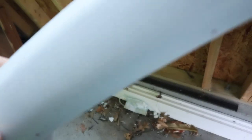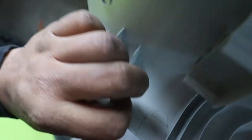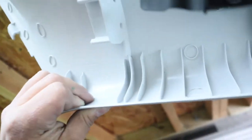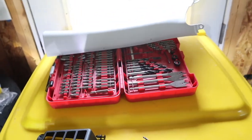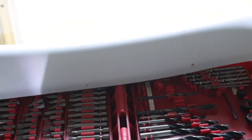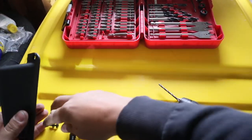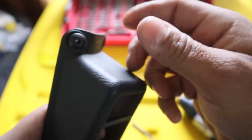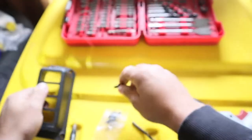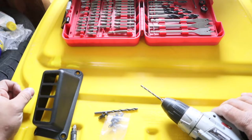We are going to be cutting back here — not a whole lot. But we're going to be cutting right over these, so that's going to be interesting. Anywhere higher would be the same, anywhere lower would just be too low, I think. Let me set this down, get everything set up, so then that way we can start drilling, start cutting, and get this thing finished. So I have the piece sitting there. You can see the red marks, top and bottom, where I'm going to be drilling. Down here I have a plastic piece and also the screws that go with them. The hole is going to be just as big as this plastic piece — it's going to pop in and then you're just going to screw in into the car. I'm going to start off a little smaller, work my way up to the bigger piece, and then we'll look into the Dremel cutting next.